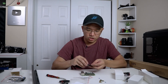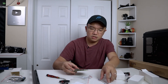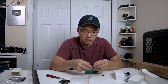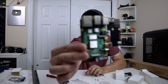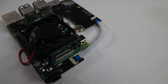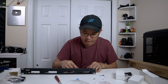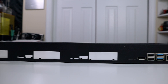According to the instructions, the HDMI plugs into the HDMI port, and the micro SD card ribbon cable plugs in right here. Then you fold or turn it - it would have been better if you could flip it for a cleaner look, but there we have it - installed. Then you put all the heat sinks on. Now we plug in this board with the standoff. These screws are all the same so I don't have to worry about which one goes where. Then we have four screws left that will mount into the rack itself. And there we have it - that is it. Actually looks pretty good.